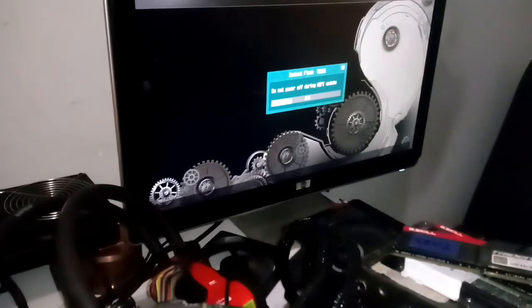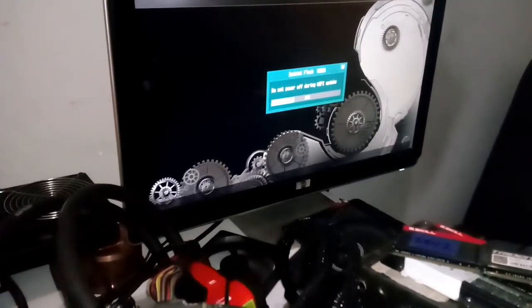However, when I went and flashed from DOS, the quarter multis were no longer there. So flashing from DOS is a clean flash, and for whatever reason, sometimes with some BIOSes, especially when you're going forward and back a lot, they are not overwriting certain parts of the AGESA. So this is why I flash from DOS. And it can probably create interesting bugs like the 15.5x bug.